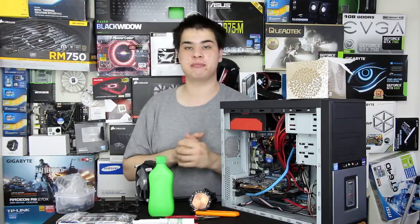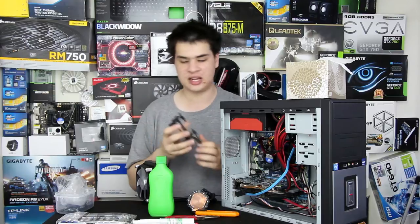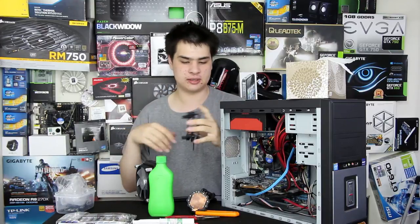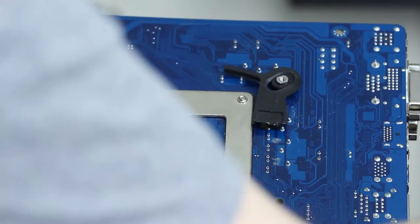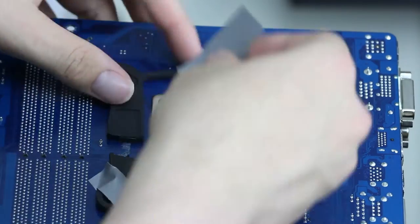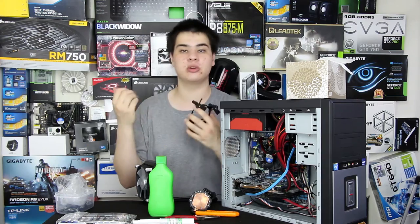On the Intel platform you generally won't have a standard back plate to remove. Now prep the liquid cooler by removing all packaging. Line up the back plate with the socket and push it in — if it doesn't have sticky tabs, use a bit of gaff tape to hold it in place. Then take the retaining bracket, put it over the notches, and line up the CPU cooler. At this stage you can choose which orientation you want so the branding faces up nicely through a window.